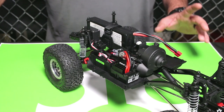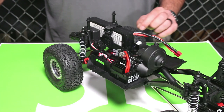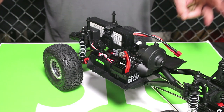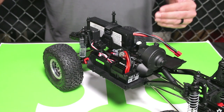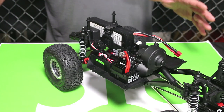The first thing I want to talk about with the AE5 ESC are the tones you get when you plug in the ESC — they're telling you something. One short tone indicates a nickel metal hydride battery, two short tones will indicate a two-cell, and three short tones will indicate a three-cell battery. After those short tones you'll get one long tone, which indicates the ESC is initialized and ready to go.